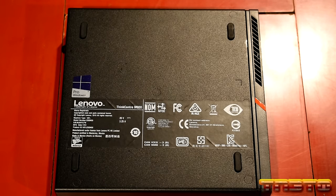Windows needs to restart. We'll go ahead and click restart now. Or I'll just let it do it by itself. It should automatically boot the M.2 drive because remember we changed our boot order. So it shouldn't throw us back into Ventoy. Okay, let's see here. Hard drive tail light is blinking. That's good. This always takes a few seconds. Okay, that's a good sign. That's a very good sign. The hard drive taillight is definitely blinking now.